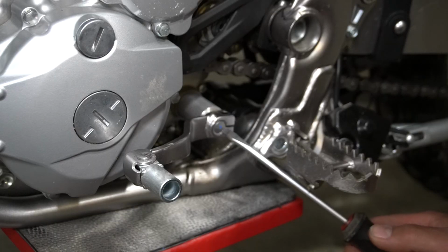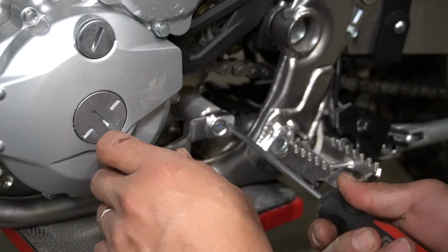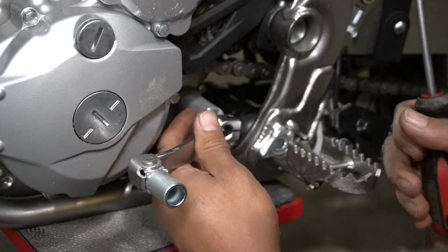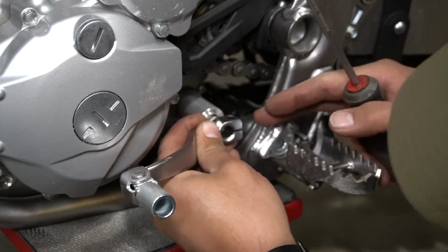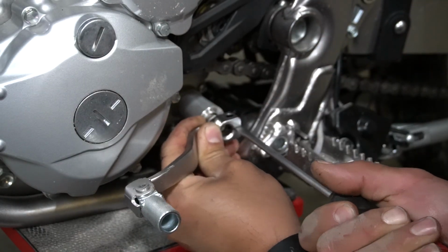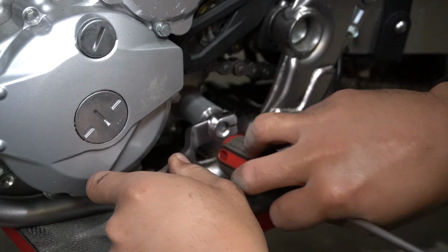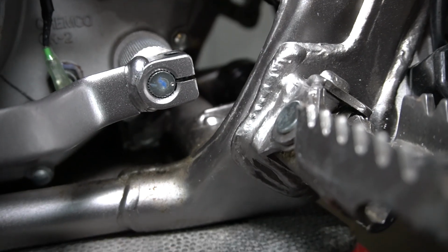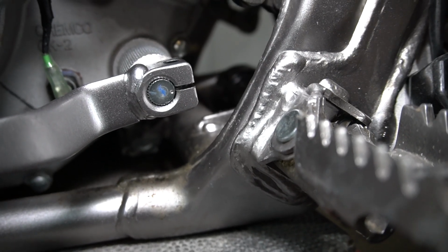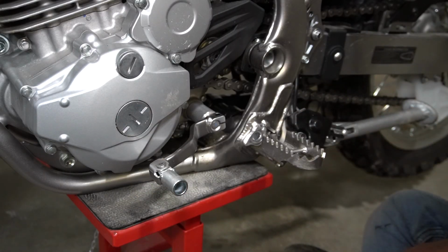So there's a small drill detent mark here, and we had the shifter aligned with that the first time around. As I take it off, I'm going to try to index the slot a little bit above that, and we'll just go one spline at a time. So there we are, one spline above it. Which ironically, we're probably back where the factory one was, but we'll see.